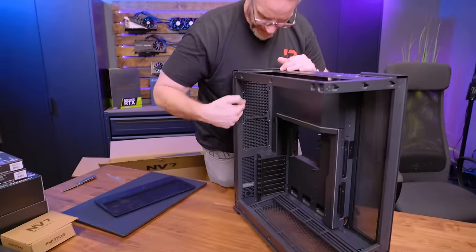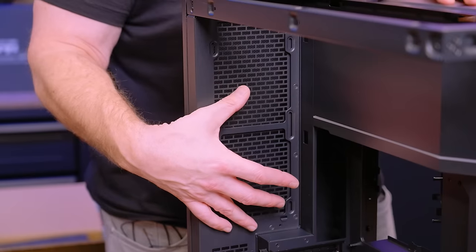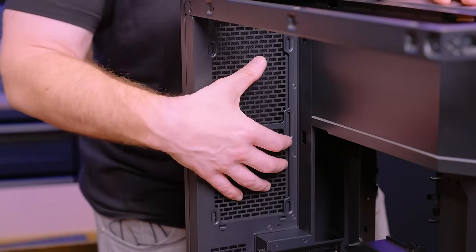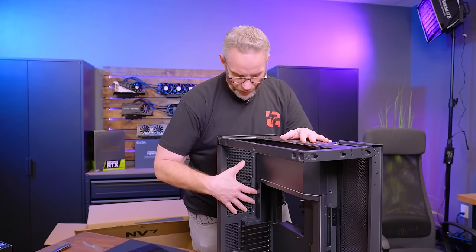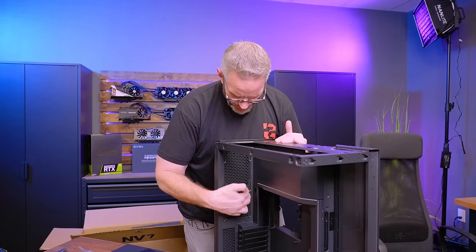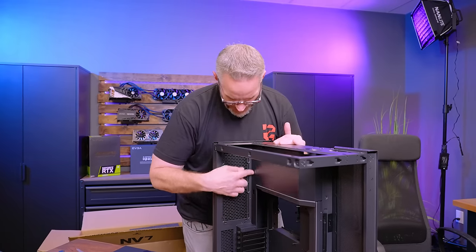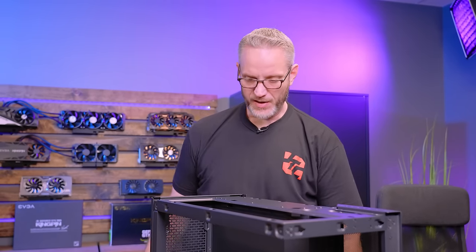Check this out — you can fit two exhaust fans, which also means a 240 rad right here. It's not just because it can fit two fans; they actually specifically call it out. Because having room for fans does not mean it could fit a radiator. You've got to check how much room there is to clear where the fan mount is and the side piece — if it were real snug, radiators tend to be a little wider than the fans and it wouldn't fit.